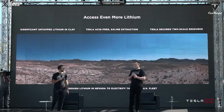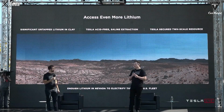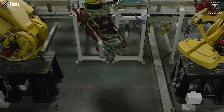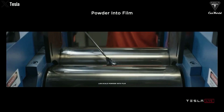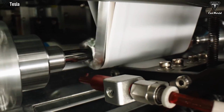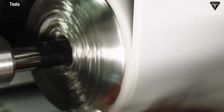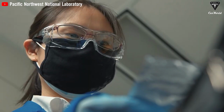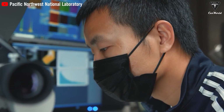One major way Tesla could achieve this is by incorporating more silicon into the battery's anode. Tesla recently filed a patent related to enhancing the 4680 by adding silicon to the anode, although silicon could cause issues with expansion and cracking the anode material. This could lead to faster charging and higher energy density, but might impact battery longevity. Some new tech, such as the highly elastic binders and new electrode designs, could help address this issue.